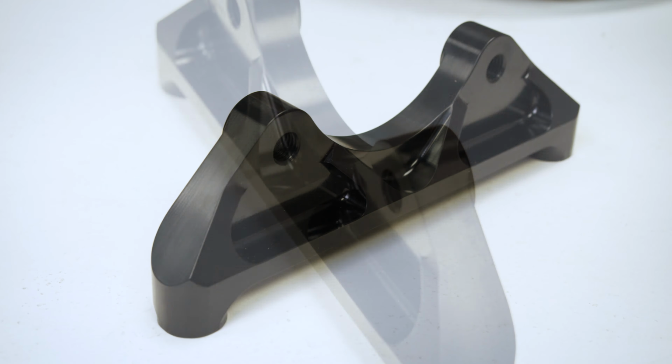Now, it doesn't come with stainless steel replacement braided brake lines, as many GT systems do. Brembo has determined that since 2014, the Chevy Corvette has come with extremely high quality and high performance brake lines, and that's nice because it does make the install a little shorter and a little easier, and those brake lines are going to perform at the level that you need, most of the work coming from this BM6 caliper. Now, of course, if you have stock brake fluid in your system, you're going to want to get some Brembo replacement fluid. Doesn't come with this kit, but flush the whole system with proper brake fluid because it's going to make a big performance difference when these brakes heat up.